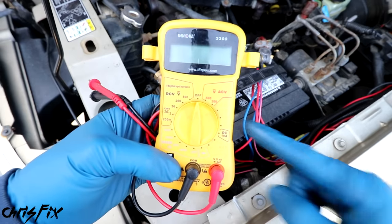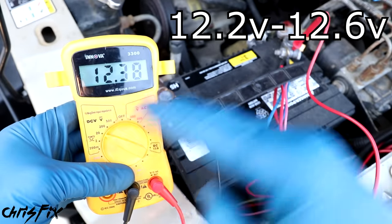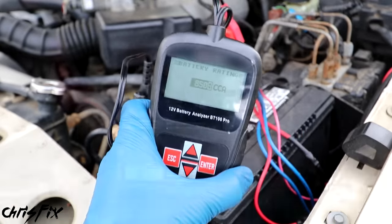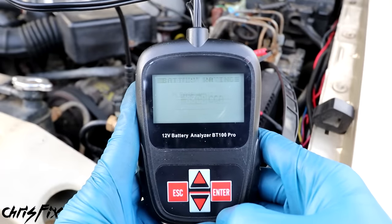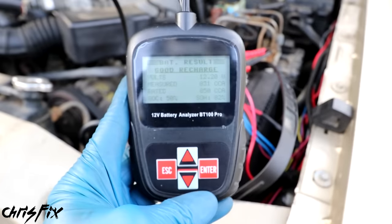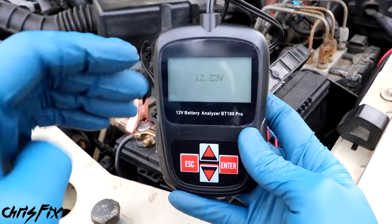You can check a battery really easily with one of these multimeters. Just set it to 20 DC volts, grab the two leads, touch one to one post and one to the other. You can see our voltage is almost 12.4 - you want your voltage to be at least 12.2 or above. If it's lower than that, try charging your battery and see if the car will start. Testing voltage helps, but it doesn't tell you the whole story because it doesn't put a load on your battery. So you can get a load tester like this, which will test the cold cranking amps under a load. We want to look at cold cranking amps, which is 850. We put it to 850, hit enter, and it tests the battery. Compared to the rated 850, we have 831 cold cranking amps - that's a good value. If it was significantly less, like 600 or 500, I'd consider getting a new battery. Most local parts stores will load test your battery for free, so just go ask.